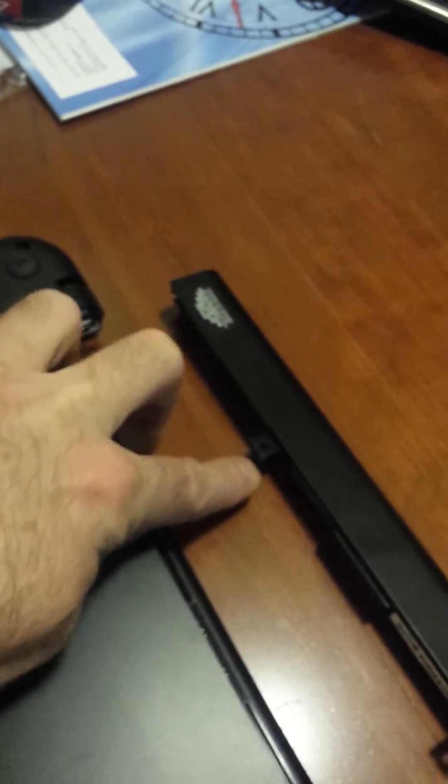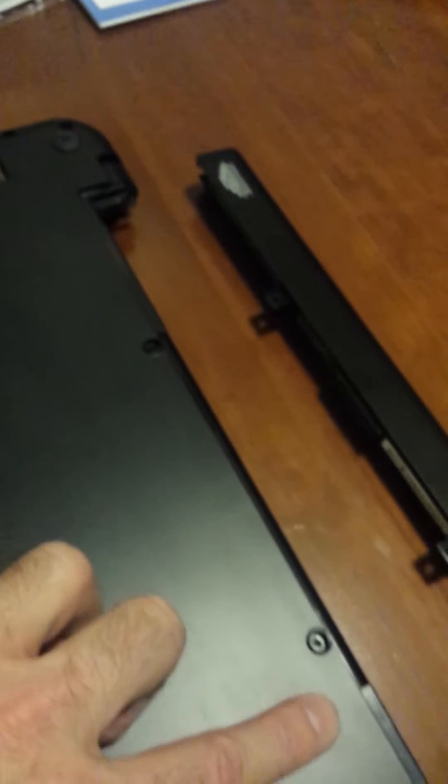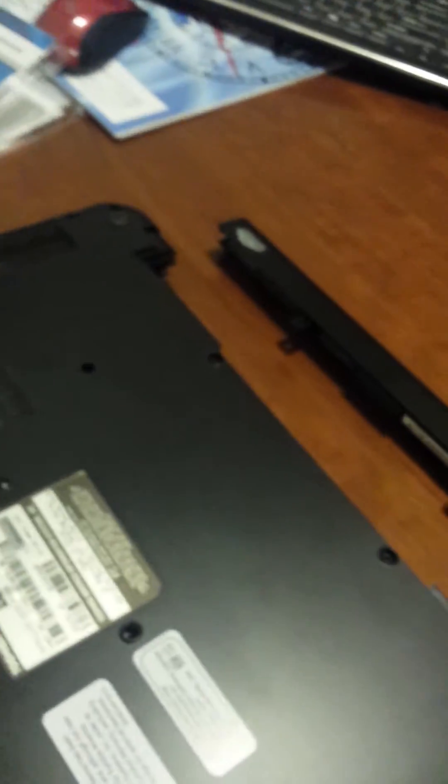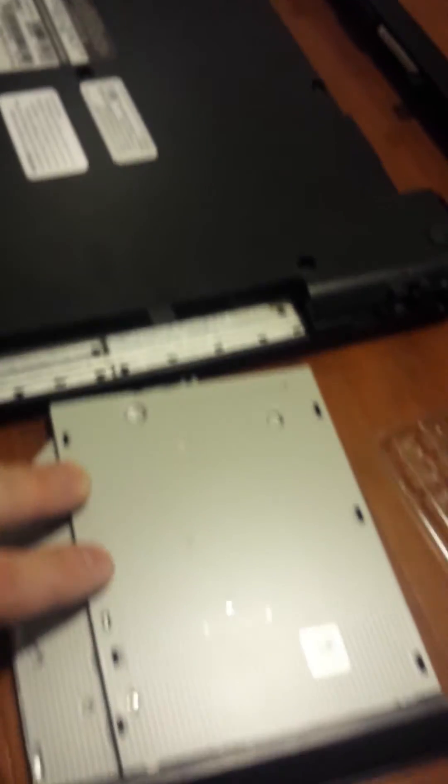Then there's the CD-ROM, and there's the battery. The battery fits in there with two screws right there and there. So you can take the battery out — take those two screws out first, take the battery off, then take that screw out and the DVD will pop out and slide out.